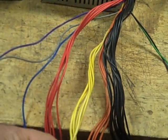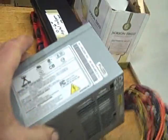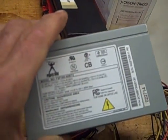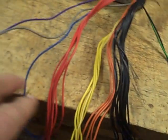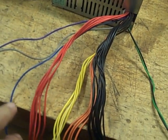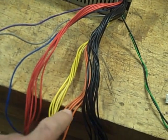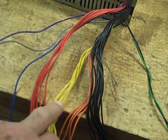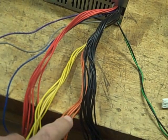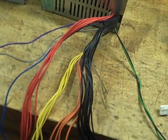The ratings on the side of the power supply box — they're usually here and you can see them — will give you the number of amps that each voltage provides. The 24 volt difference between the yellow and the blue is very limited, about half an amp usually. But you can get 20 amps out of the 5 volts, and 25 to 30 amps in some cases out of the 3 volts, and at least 15 amps out of the 12 volts.